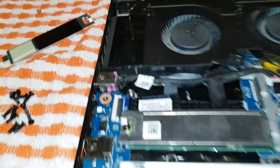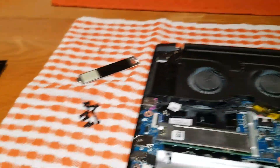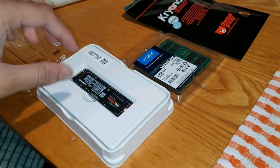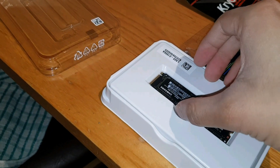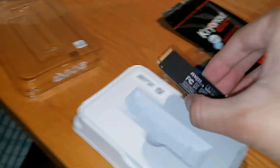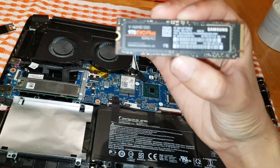Make sure you don't lose the M.2 screw — if your system doesn't come with one you can order it on Amazon. There's a heat shield here; lift it open and take it out. As you can see it has a thermal pad that captures heat and spreads it across the shield. There's a PCIe NVMe slot here. Get the new NVMe SSD out — make sure you're fully discharged of static before handling it. It looks really nice.